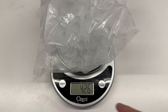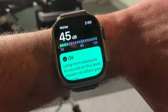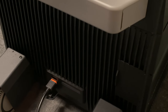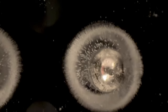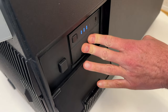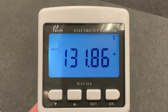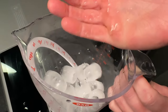I made four batches total — two small and two large — and together those equal basically one pound of ice. The fans are loudest when making ice, ramping up to 45 decibels at one meter, but that's only about 10 decibels louder than the background level, and it has a nice soothing fan sound. A few things to know: you can't make ice with the 12-volt connection only — you need the internal battery installed or to be plugged into the wall, because it pulls a lot of power. When I measured it, it pulled 130 watts, and I estimate this uses around 30 to 40 watt-hours per batch.